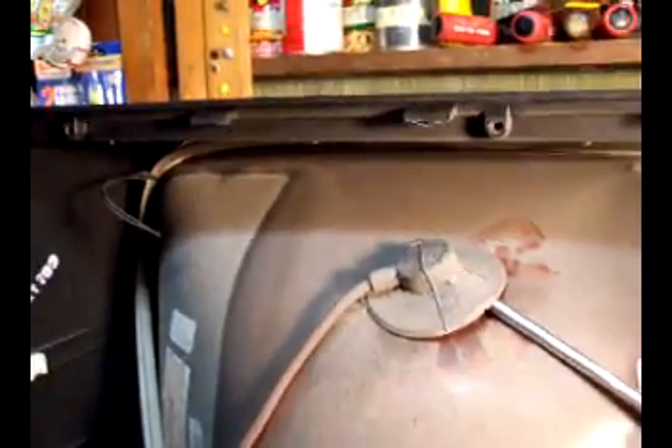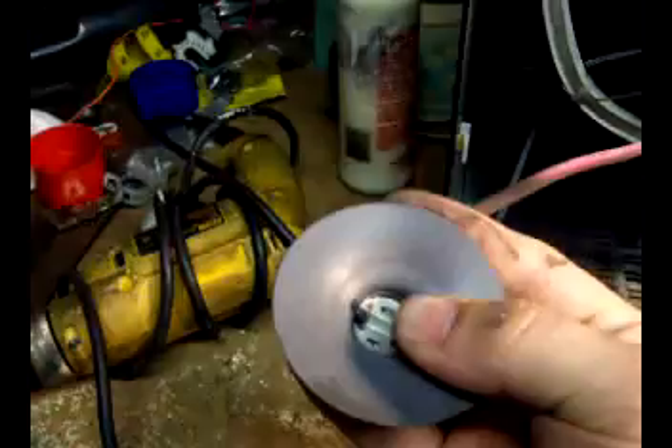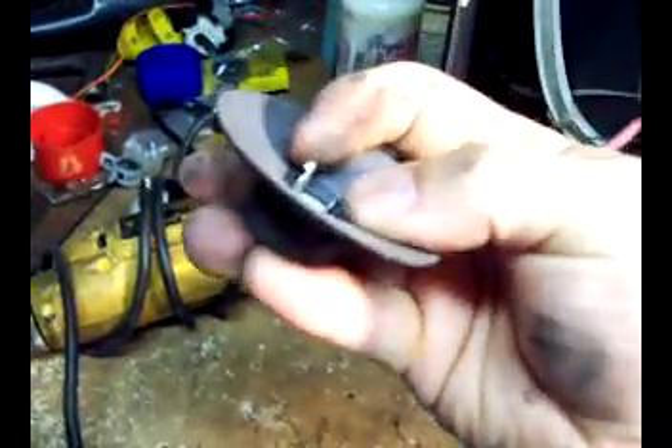Some of these you should just pinch. Since we don't care about the picture tube, I just popped it right off. Usually you want to be careful — pull the suction cup back and push in on these two tabs. That releases it from the picture tube. If you were going to reinstall this, you want to clean that area. What I'm doing is taking one side of the prong, locking in onto the washer, pushing the other side down, and it's locked in.